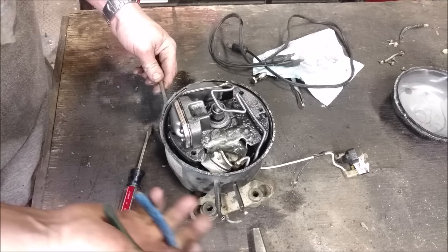The refrigerant is just sitting all in this case right here in this little football dome area. It pulls in the gas — and there's liquid in there too — but it pulls in the gas and this has usually baffles up and down so the liquid falls out and it just keeps the gas. The gas comes in here and the motor compresses it.